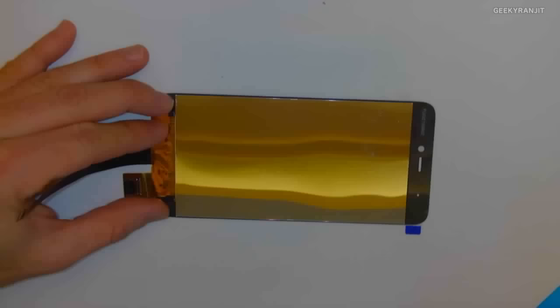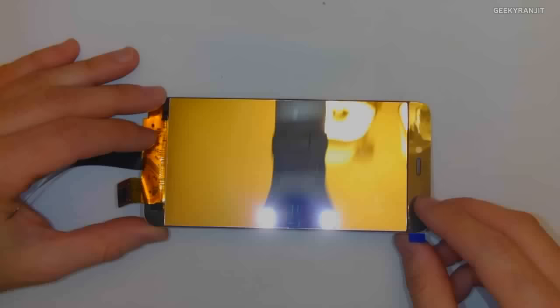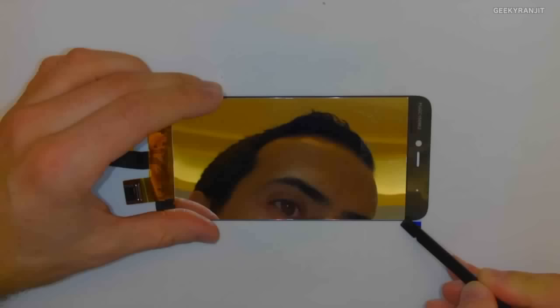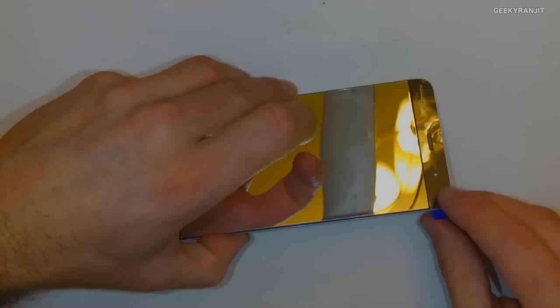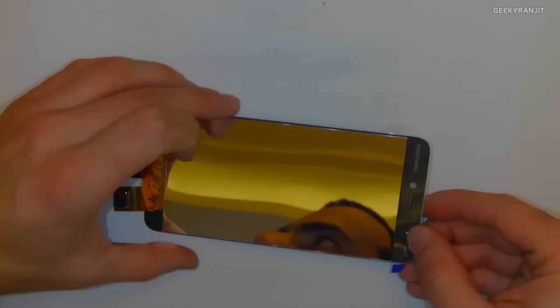And what you're looking at here, this super shiny surface, this is basically a reflector piece. And this is actually pretty important. The more reflectivity, of course, the more light it'll bounce out of the display. So this is actually made by 3M. It's the best reflector in the world, the highest quality reflector in the world, which is why it's so thin. It's like a very thin sheet of metal, but it's almost like a perfect mirror in many ways. And you're looking at the underside here.